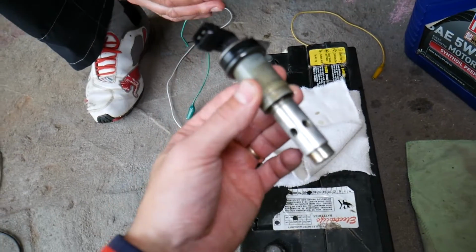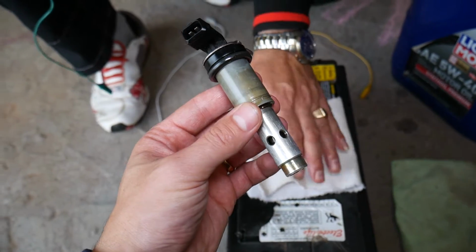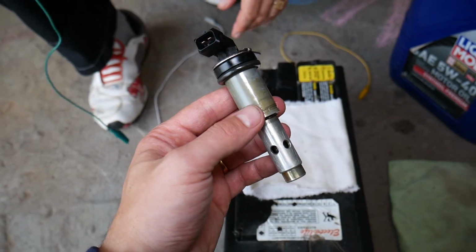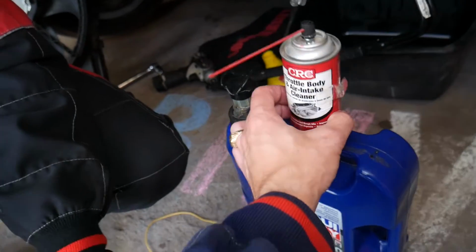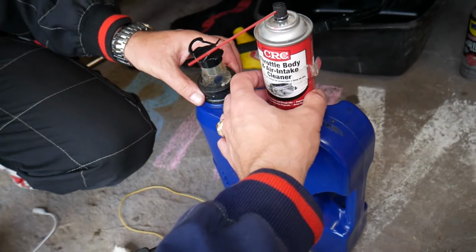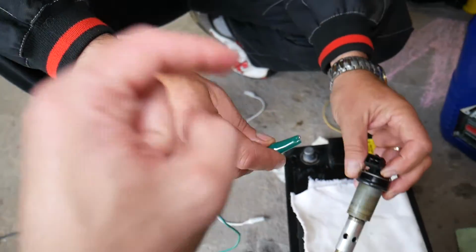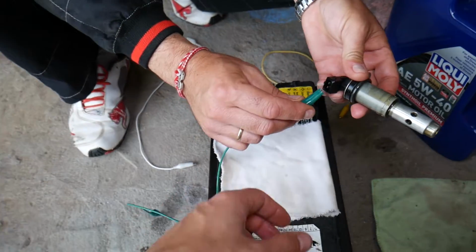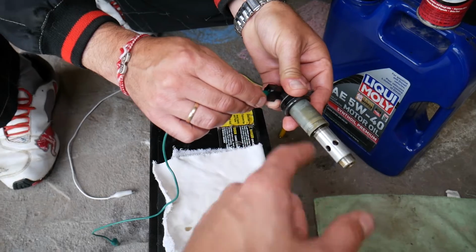So that's the solenoid. In order to clean it correctly, we need to cycle it open and close, and while we're doing that, we're going to be cleaning it. What we'll be using right here is throttle body and air intake cleaner. Then we'll use some engine oil. We'll explain about all that as we go. We need to get some alligator clips, and we'll put the links for all that in the description of the video below. We're going to connect the alligator clips to the two wires.